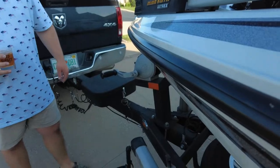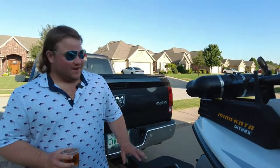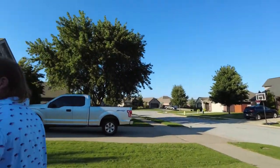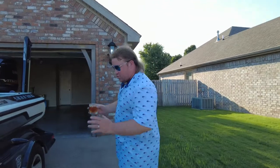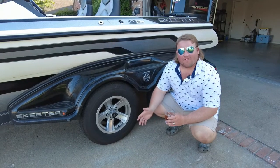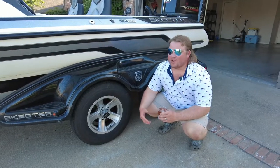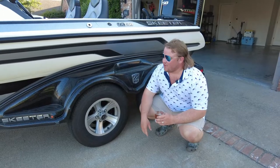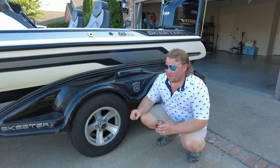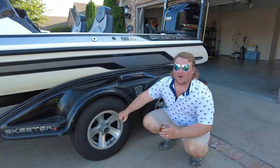There's also a Fulton jack — very big, very robust. You definitely need to grease it to make sure it moves because it was a little tough at first. This boat comes equipped with a dual axle trailer with disc brakes on the back. When we first brought it in, I didn't hook it up to the light switch, and we tried to back it up and couldn't because the brakes engage. So make sure you plug in your wire, because if not, your brakes won't engage.